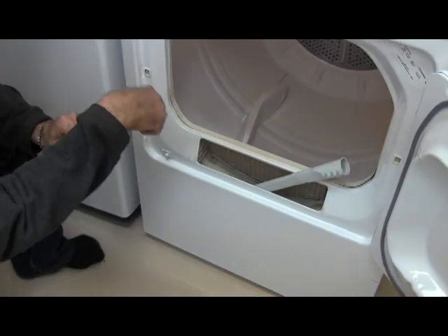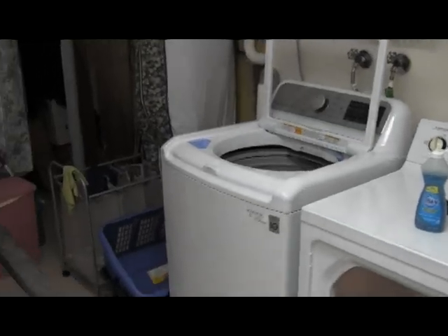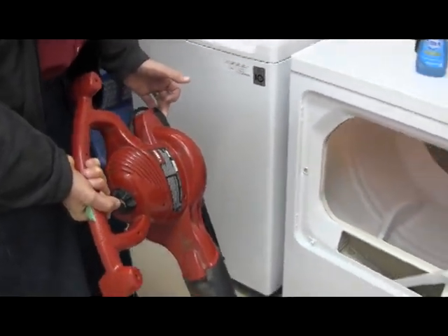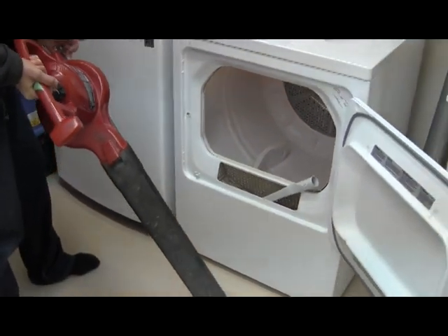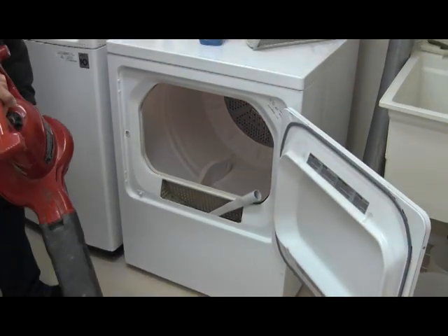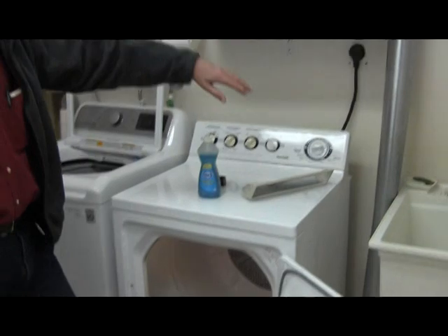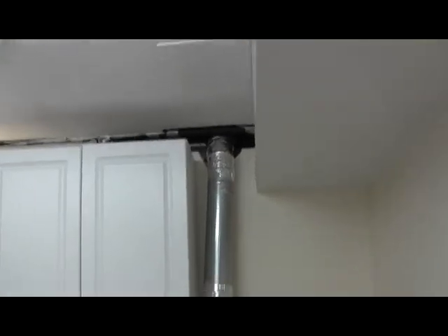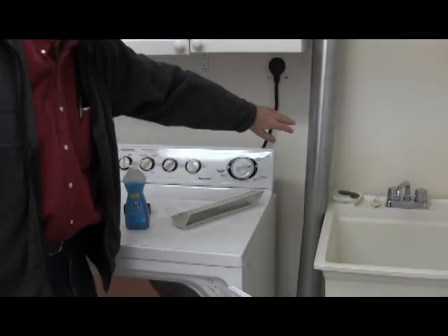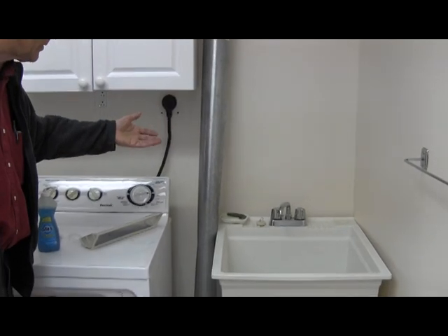I cleaned it out, and since then about every two years I've taken the dryer apart and looked, and there was no further accumulation of lint. A third option — some say MacGyver — but this is a leaf blower, and you can use it. It's going to create a mess, but you can use it once you've cleaned this out with your vacuum attachment to take most of the lint out. You can use the leaf blower to blow into this area to force the lint that is in the vent pipe out to the outside. The only thing is, if lint has built up in the pipe for a long time, this probably won't dislodge it — but if your pipe has been cleaned fairly regularly, it's my guess that it would keep it cleaner.